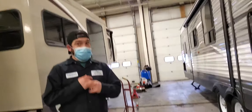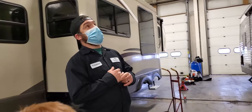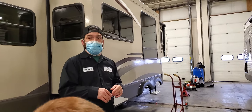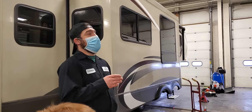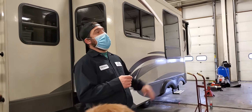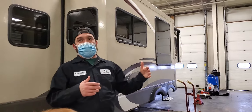So you have a one-piece rubber roof. Only rubber roof certified sealants can be used on it. The sealants that are up there right now — we've already gone through the whole unit. This unit is in meticulous shape; they did a great job keeping it. Anywhere you see sealant up on that roof is what you need to maintain on a yearly basis.